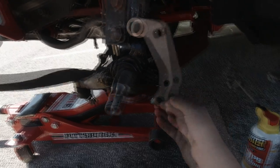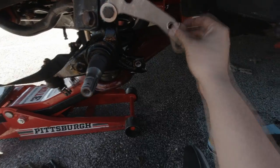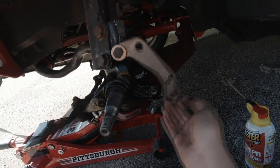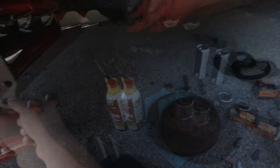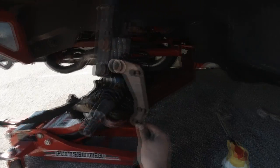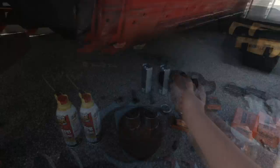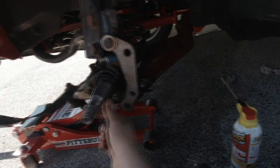Welcome back — we have them both drilled and tapped. We did have to drill one hole bigger; they made a mistake and didn't drill it big enough, so I just drilled a half inch — slightly sloppy in there, but that doesn't matter. Now all that's left to do is put some red Loctite on and tighten this down. I'll show you part numbers for all the bearings for the actual spindle. This is it for all the big modifications: cut, drill, and tap. I won't be needing that dust shield — whoever wants to buy those I'll include the powder coated dust shields, because you don't need them for this upgrade; it's already contained with the new rotors.